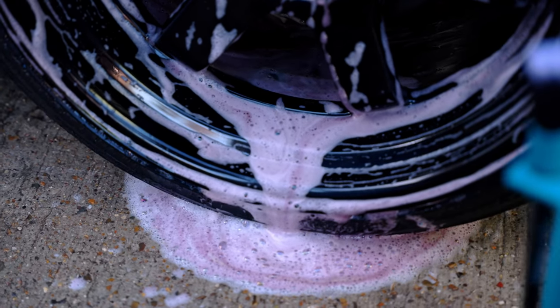What is it that causes it to go purple? That is a reaction with ferrous metal. So there's basically an acid in iron removers, reactive wheel cleaners, things like that, that when they hit ferrous metal contamination, which is what your brake discs and brake pads kick out, it turns purple. That is actually the product reacting. So it's actually an indicator when you're using it on bodywork to remove contamination that's on there, usually rail dust or industrial fallout, that indicates that there's actually contamination present. So these color changing wheel cleaners originally were never color changing wheel cleaners. They were used to remove bonded contaminant metal particles from paintwork. But now people found out they work really, really well on wheels. So every wheel cleaner is now an iron remover, basically.